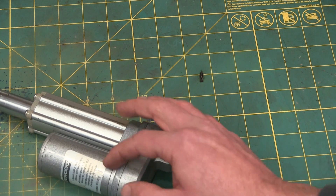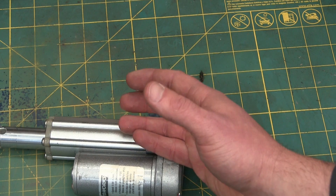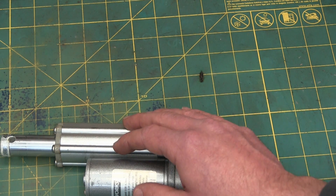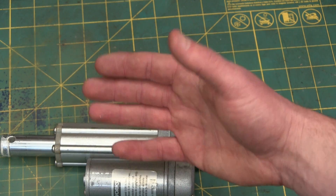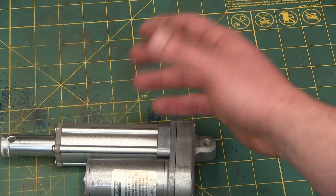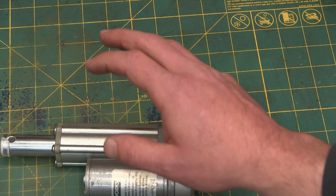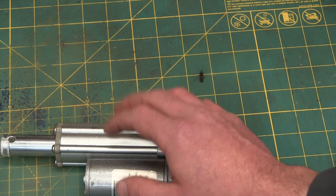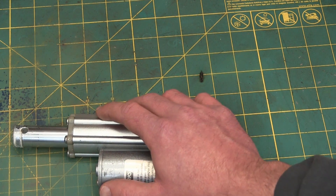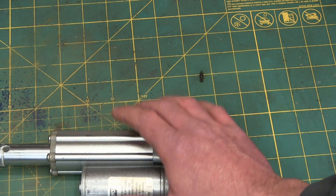There's a whole gear train in here and a whole bunch of rotary elements, and they are prone — the more moving parts, the more complicated, the more prone it is to breaking down. Somebody will throw this into a system instead of a hydraulic cylinder and it will work nominally for a short time, but you'll end up replacing it a lot more. A hydraulic cylinder has one moving part, it's got a mechanical seal and it's always bathed in oil — very skookum. These things, not very skookum. In applications like the mining industry and heavy industry, there's a lot of vibration going on. All of these little parts are vibrating so even if it doesn't move or actuate, it still wears right out.